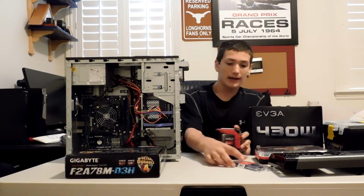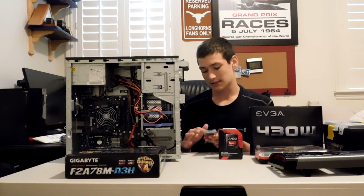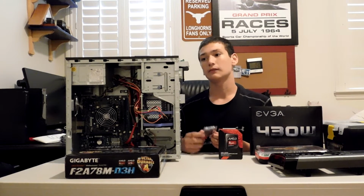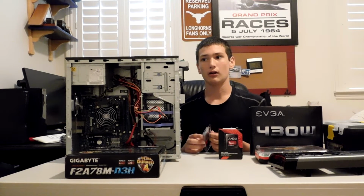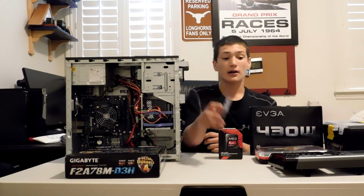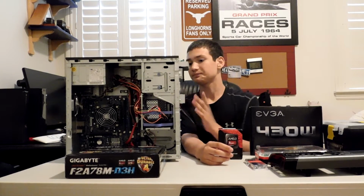And we do have, I think this is DDR3 1333 megahertz, and I don't really like mixing 1600 unless I go take it down. But if not, I do have an extra. I think I have 2 extra sticks of 4 gigs of DDR3 1333. So if we want to go 16, I'll just keep this for another customer and put that one in here.